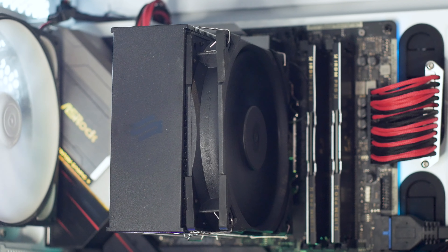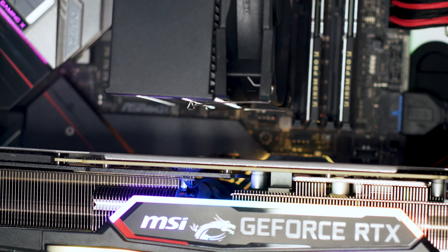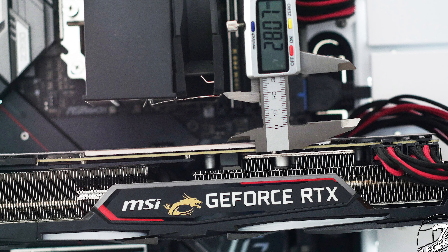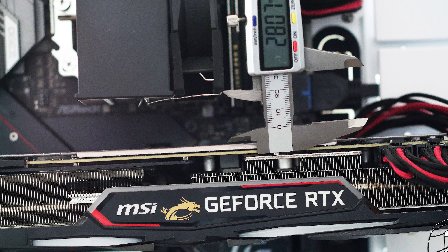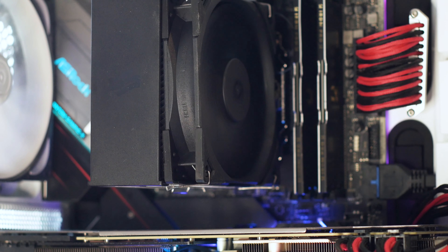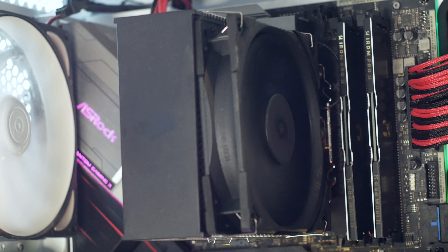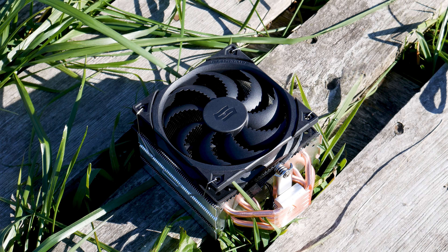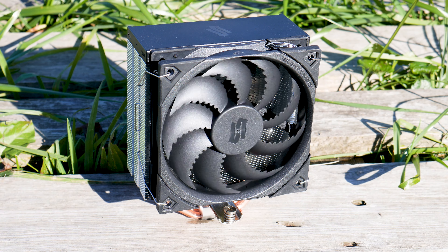In terms of graphics card clearance, the space between the sides of the heatsink and the backplate of the graphics card is approximately 28 millimeters. However, don't assume that will be the case for you, because modern motherboards usually have a top-mounted M.2 socket that will change the distance between the CPU socket and the PCIe slots, so keep that in mind. Before testing the cooler, you'll hear a noise sample starting from a dead stop up to its maximum rated speed of 1,800 RPM. A decibel reading is useful, but it doesn't account for other noise sources such as bearing ticking or vibrations.